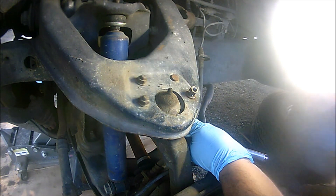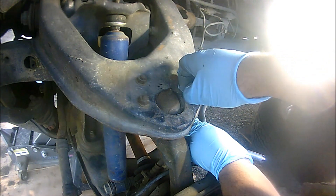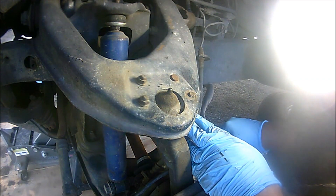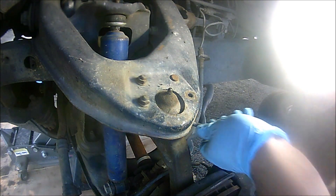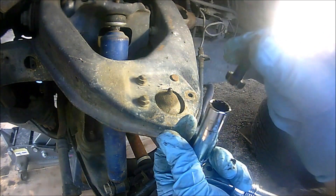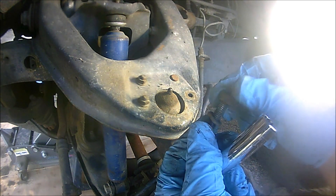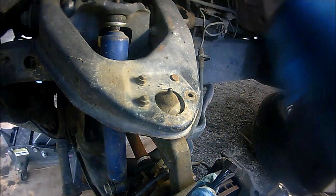See how we have a washer and the nut - once I remove the deep socket I can remove the actual nut. All I'm doing is supporting the bolt from the bottom with the 13 millimeter deep socket, and from the top I'm removing the 12 millimeter nut. I'll do that for the rest of the bolts and then we'll continue.